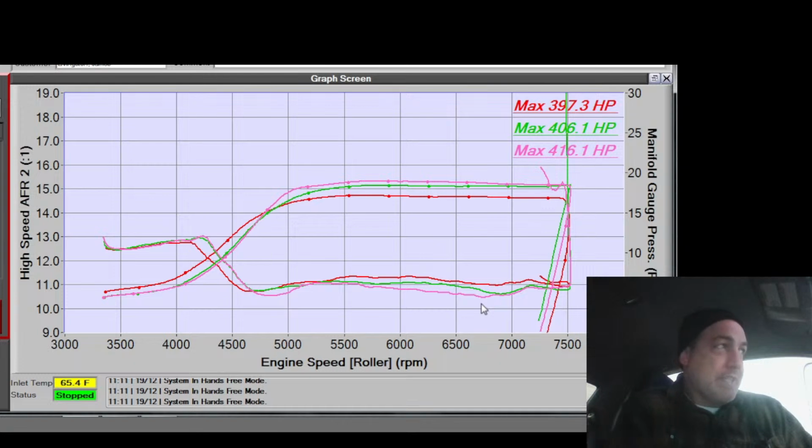So I should test that. I should try that on my other car. Run really high ethanol and pull the injection timing down to when the valve is open, just during cranking, and see how much it helps with high ethanol. I imagine it would help a lot, because it would definitely get more distributed. Whereas when the engine's running, the back of a closed valve is really beneficial.